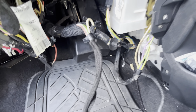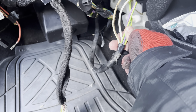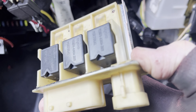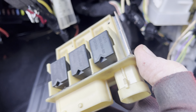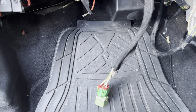So if you've got a Berlingo on a 58 plate and you can only get speeds 1, 2 and 3, obviously check the resistor pack. This is your speed 4 relay, which is tucked right up behind the back of the fuse box — you'll only see it sticking out at the bottom. Head for the right hand side of the fuse box, black box tucked down the side — that's speeds 1, 2 and 3 main wires. Thank you for watching.